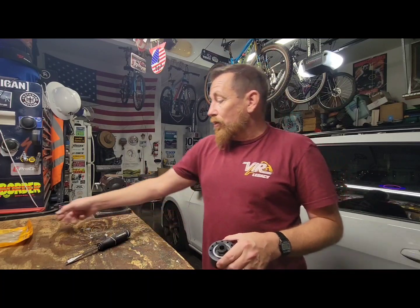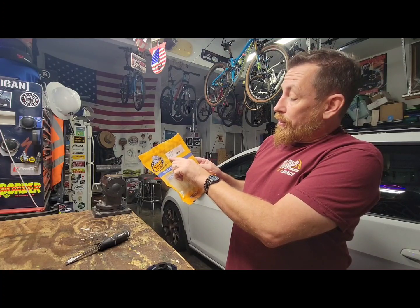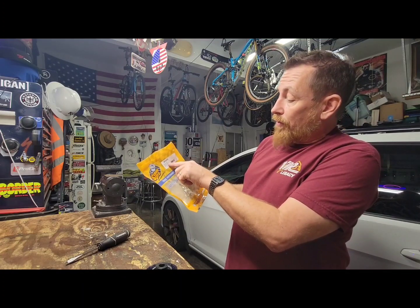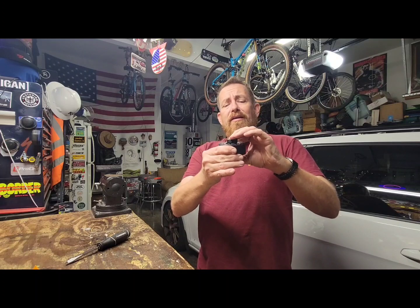These had 1.5 years on them, about 18,000 miles. That's about 15 track days. Maybe that's kind of normal, because this bag here says suspension parts, the alloy 0018K, which is the number of the control arm for the Mark 7 Duroball service kit. So maybe it's intended that these things don't last forever, but that's kind of lame. They should last longer than 1.5 years.